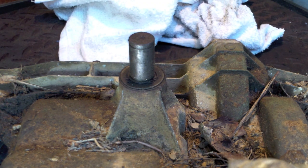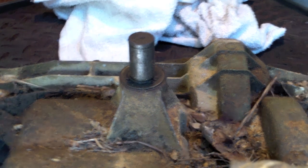Because it was on one of those cold days when there was snow on the ground, it was like 22 or 23, and I was out doing donuts, the case cracked and it just popped in a funky place. I looked at it, I couldn't see anything that was crazy or hinky. No teeth had come out, no weld had broken, and there was some water in the case as well, so I figured it had just gotten a hunk of ice in there and locked it up. Maybe I'm wrong, I don't know. But what I'm going to do is crack this guy open. We're going to put this double pulley back on there and see about closing it back up.